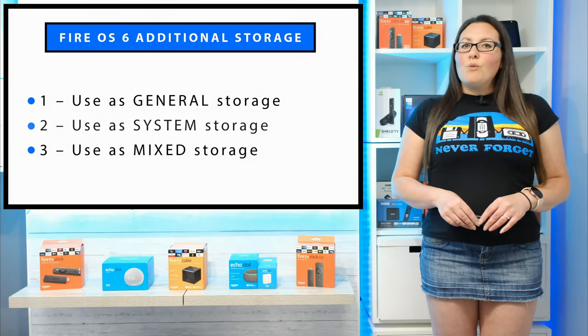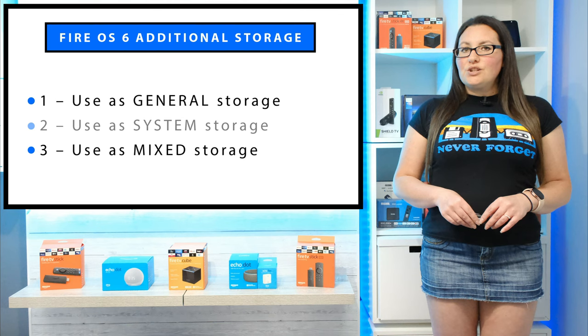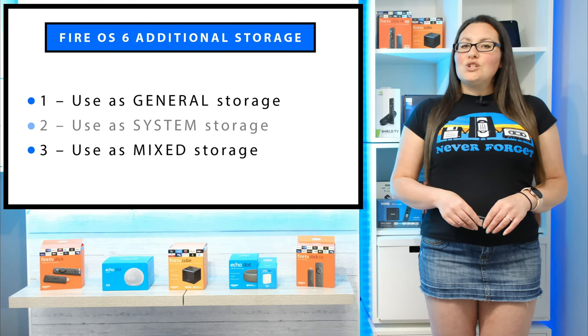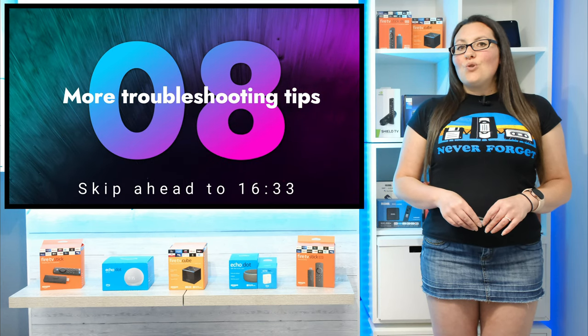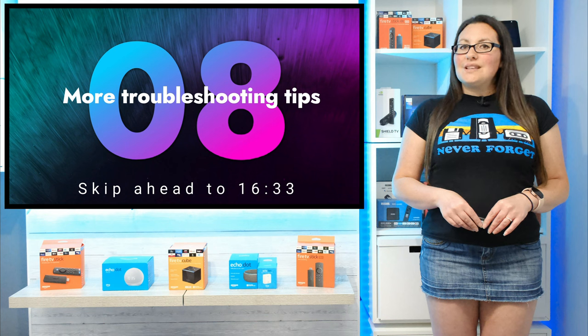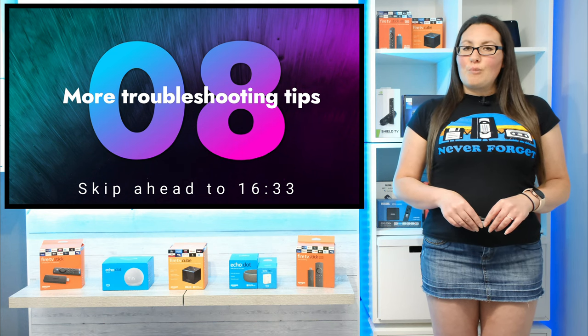If you've gone with option 1 or option 3 and can't see your storage, and you're sure that your storage is formatted to FAT32, and you're sure that everything is connected correctly, and you're sure that any ADB command was successfully completed, skip to this part of the video for further troubleshooting tips.